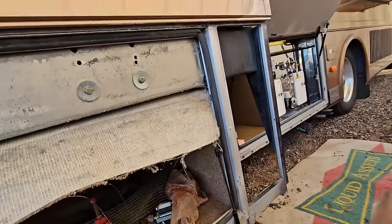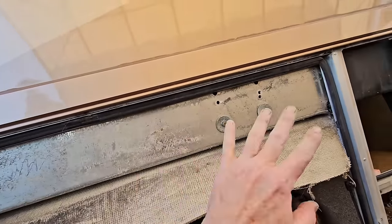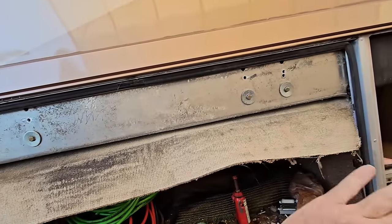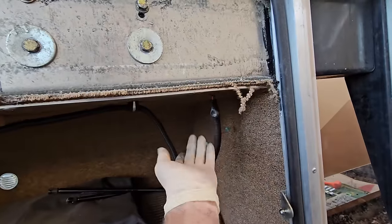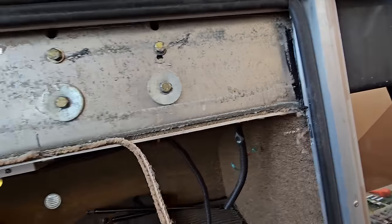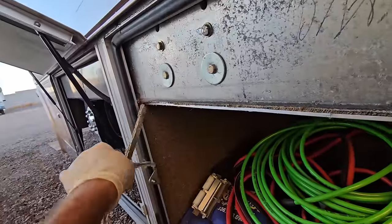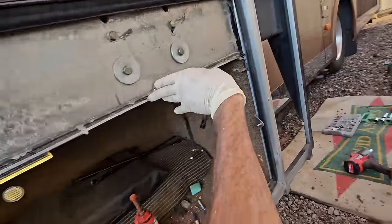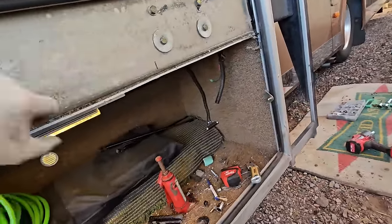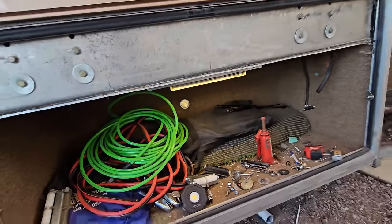The Z-frame is put back on again. I won't put the compartment door on yet — I do have to clean up my mess over there. Now I can put the bolts in, then I'll cut the carpet and paint it black once I'm all done. This sheet metal was riveted into the bottom of the frame right there, so I just got a piece of flat aluminum and riveted through the carpet into the frame. Now all I really have to do is paint this section right there. Very, very simple — and I think I'm ready to move on.